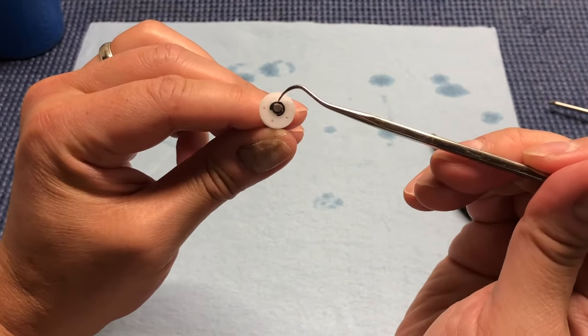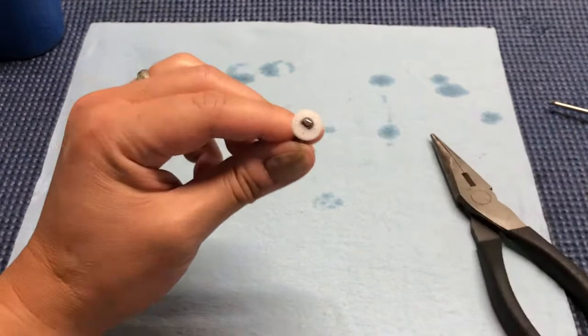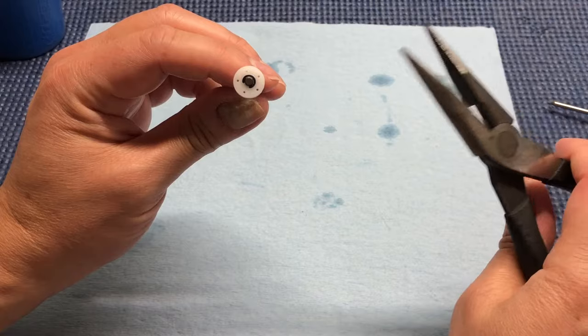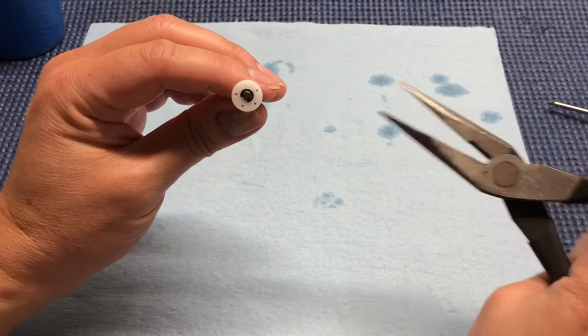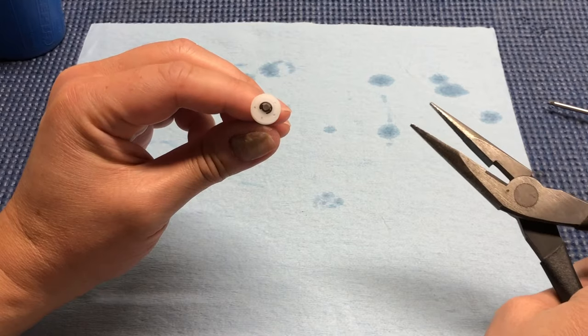So that's the trick: put one edge on top against the shock shaft and then one against the edge of the E-clip. For example, I'm putting my needle nose pliers at the 12 o'clock and about the 6 o'clock position.